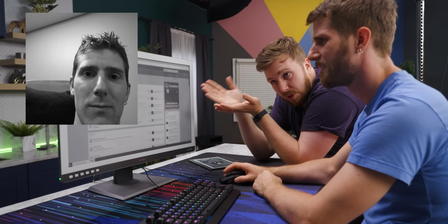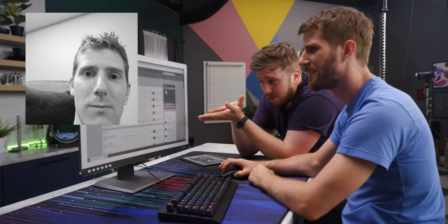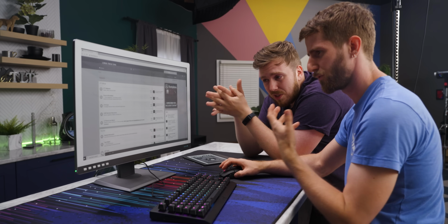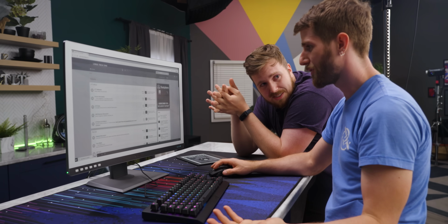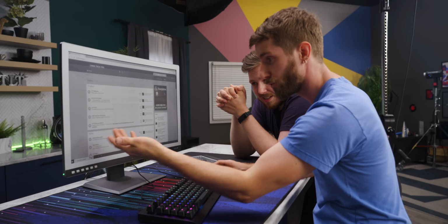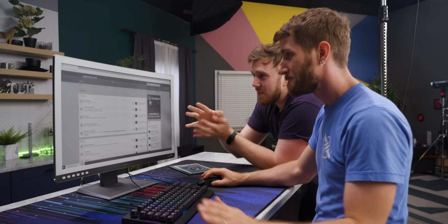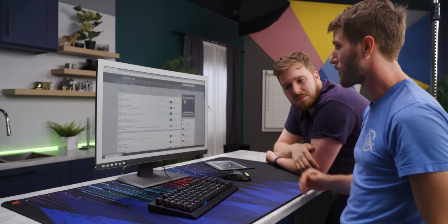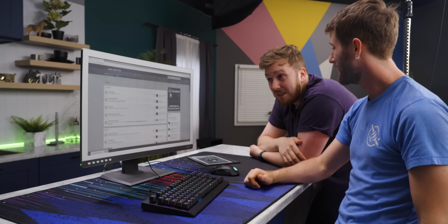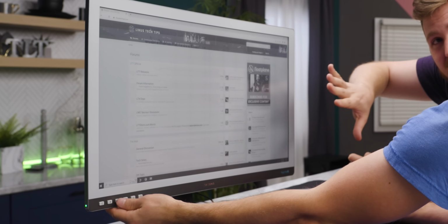Because with e-ink, you're either black or you're not, or you have to find sub-pixels that don't exist on this monitor to make gray. So you just use actual pixels, meaning that your text is not necessarily going to be that sharp unless you tweak your contrast and make sure that there are no shades of gray. And as you can see, there's supposed to be text up here. Oh no. So you're saying we found the one scenario where dark mode is not better? Yeah, it's substantially worse. It's way more distracting to have bright ghosting than it is to have dark ghosting.